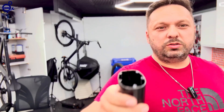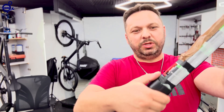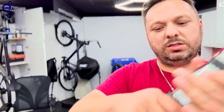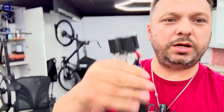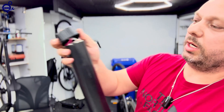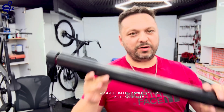Now I'm going to show you how to put it back in safely. I use a special tape in all my repairs. When you fit it back in, you'll see the BMS side — once you squeeze it, it gets slightly wider on the sides. Pass it in and squeeze it gently. Make sure it doesn't hook any wires — just let gravity help you. When you put it back, make sure not to grab or hook any wires. Then put the screws back after you've done this.